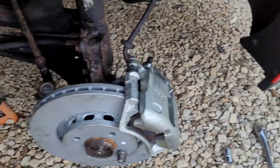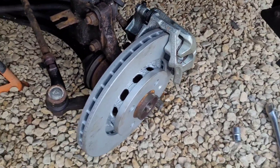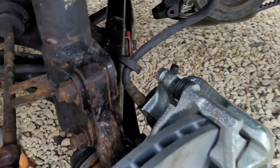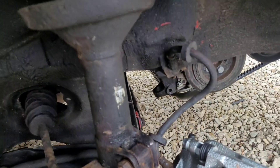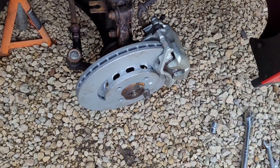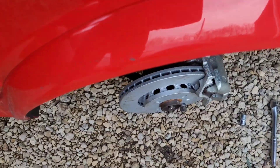Wing it back the other way — again full lock — and we still have plenty of room in the hose, it's nowhere near hitting anything. Because the last thing you want is for that hose to catch, and even a little nick, then you slam on the brakes and it could burst that hose.